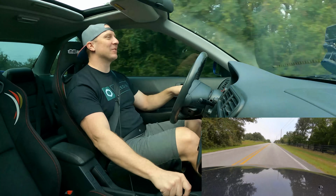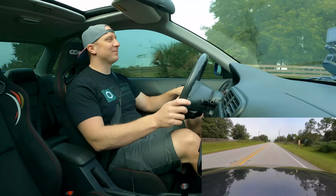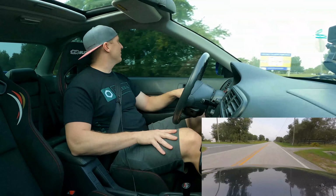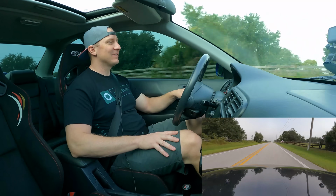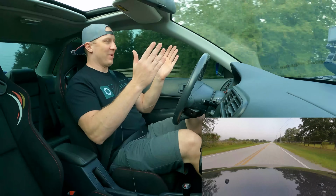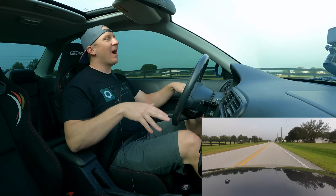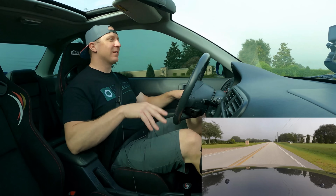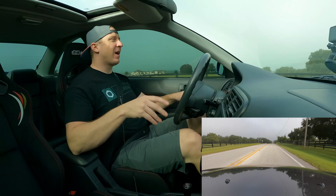You can see how much faster I'm moving in this thing with the suspension. I'm really pleased. The Motons are freaking awesome. Really turned out great. So the steering wheel's off, but other than that, the car's driving straight as an arrow, just in my eyeballing of camber. And so I wanted to keep adjusting, let the suspension settle a little bit, drive a little bit, and then go get an alignment done.